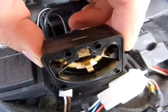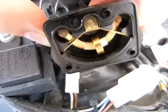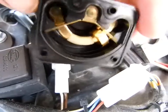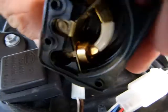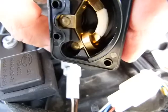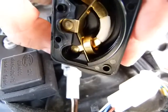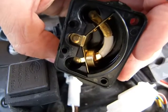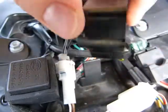In this position, because this is how it gets installed when the bike tips over — that's the position of the little ring. And when it tips over too much the other side, this is the position of the ring. That ring opens the circuit and doesn't let the power go to the ignition on the bike, and just shuts down everything.